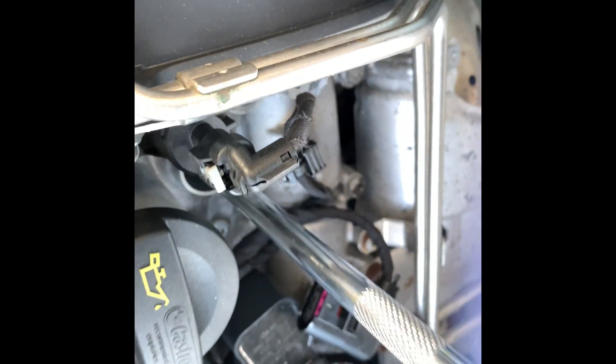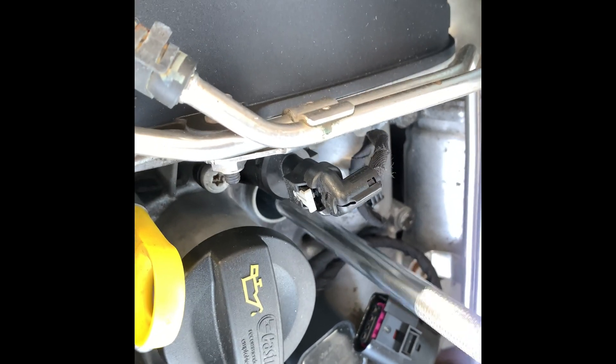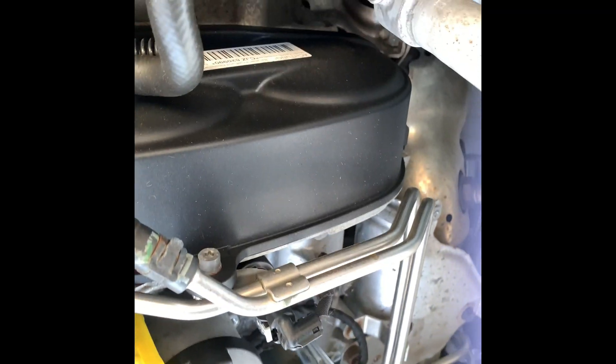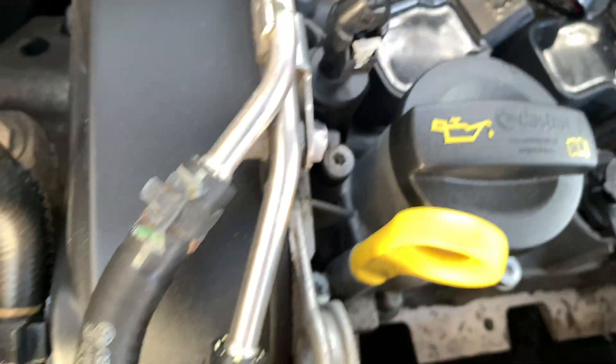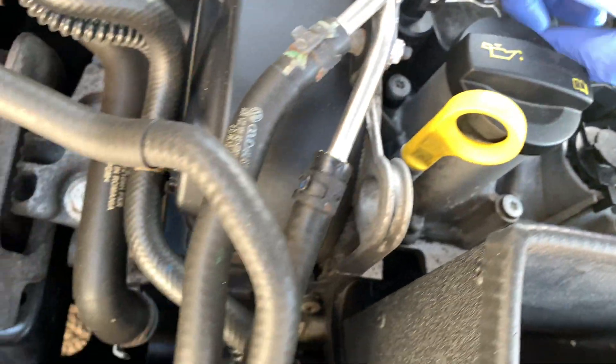The new plug comes with a little copper washer on it — I'm just going to put that in. I'm going to use two hands to tighten this time. I've tightened it down. I'm going to get the coil pack and put it back in. I'll leave this connector off for now because I'm going to be removing the rest, and I can put this screw back in as well.